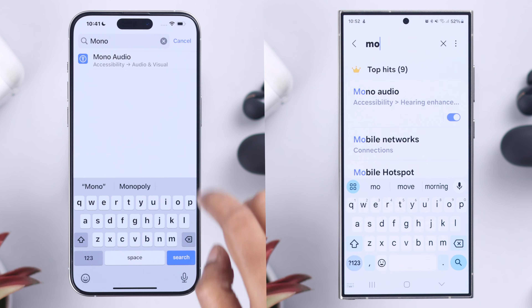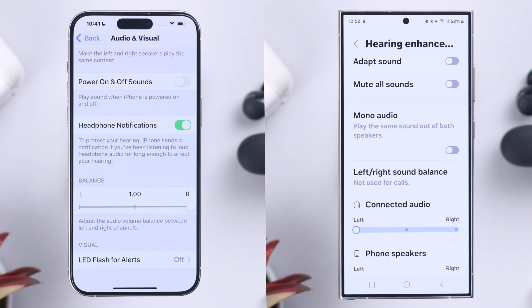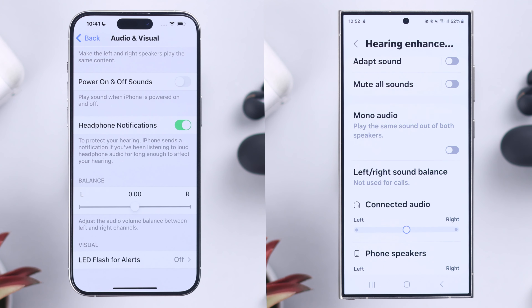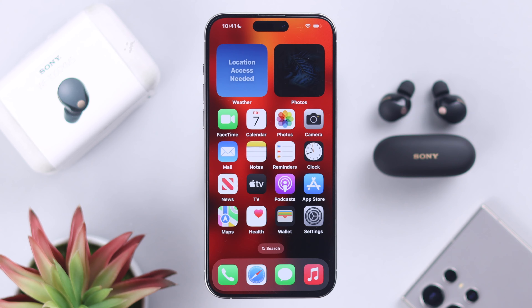Especially if you're facing only one side has sound, or one side is louder than the other — whatever device you're using, iPhone or Android — go to your device's settings and search for Mono Audio. First, make sure Mono Audio is turned off. After that, look for the balance slider and set it to the middle. If it's set to extreme left or right, that could be the cause — your one-side problem should be solved.